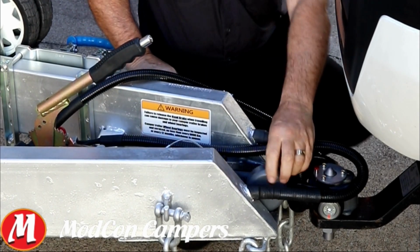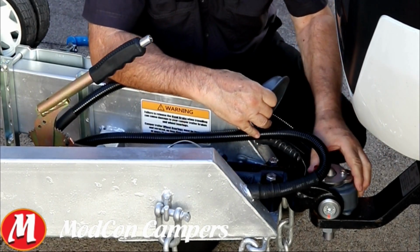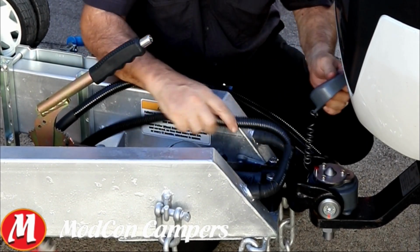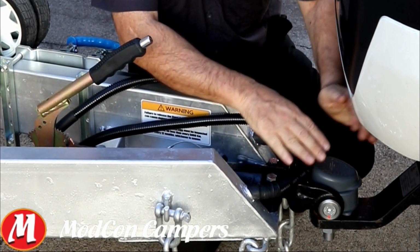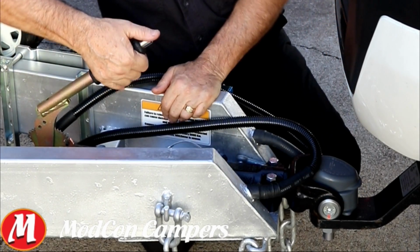Okay, now before I put the cap on, I want to make sure that everything's locked away nicely. Looks like it's all secure. The good thing about the DO35 is the cap is actually a double check. This will only fit in place if I've got it locked away properly, so I know that the coupling's done. My next most important thing is take my handbrake off.